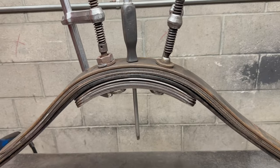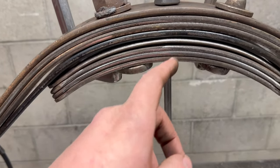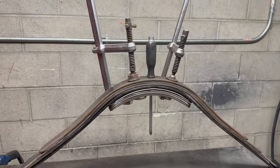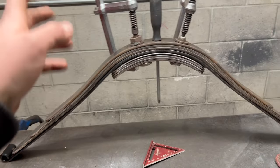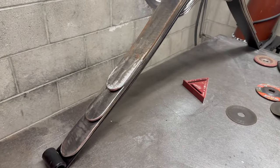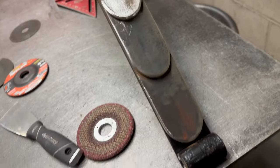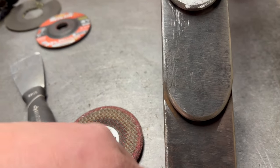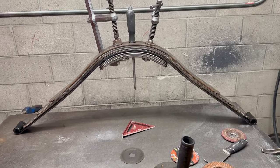It needs to be clamped down a little more — suck it up with the bolt, and the bolts will go through when it's in the frame. Counting the springs for what feels like the 19th time: one, two, three, four, five, six, seven, eight. Eight springs — one main reversed, three following the main. Hopefully that's good for the sedan. I want it to be low but I want it to ride as okay as it can. You can see where the old spring rubbed the next layer — that's about exactly the part I removed.